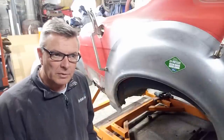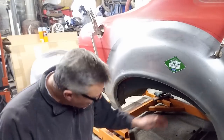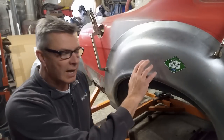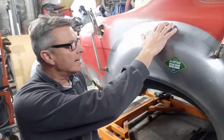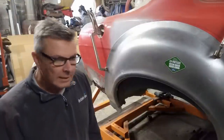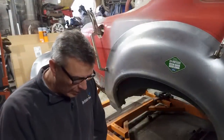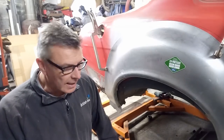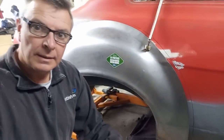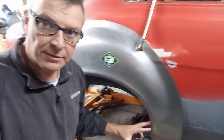I can see a couple of suggestions from Odd Autos, and I did have a look to see what they had done. They used the center line just underneath there to center line their axle and arches, but the arches they had were from Magnum, and they had a center line punch in them, and these don't seem to have that. But what I did get was a few measurements. Taffy Mark 1 said he's measured his car, and it's 410mm from the B pillar, turn that around from there across to there, which is what I was after.